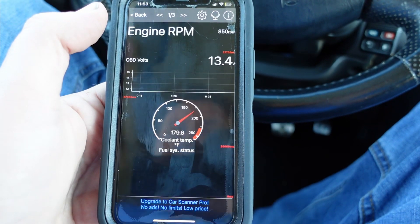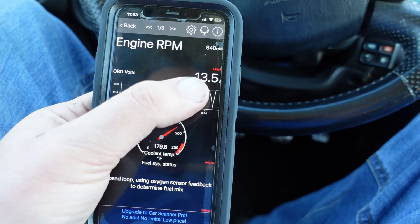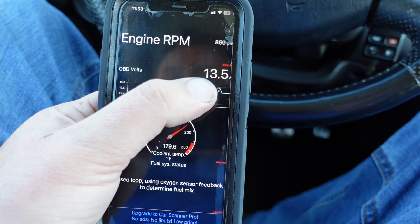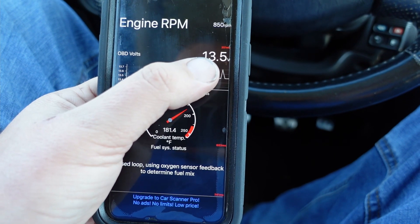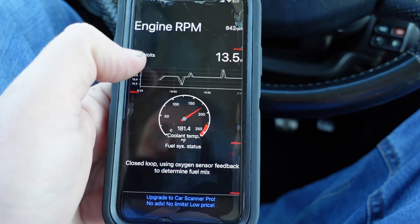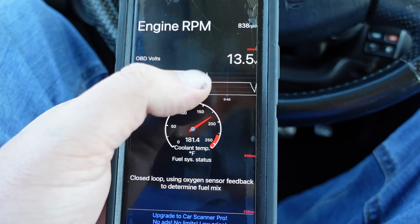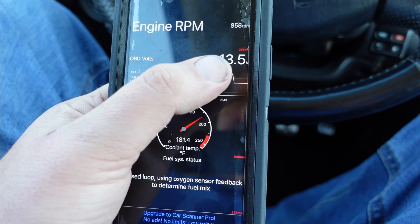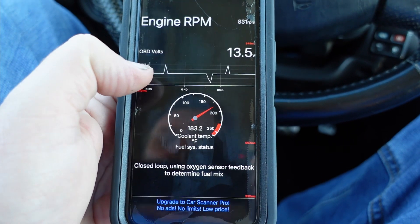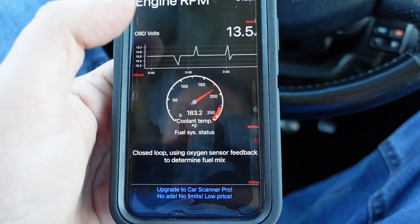Let's go to the dashboard — I'll show you what I've got set up here. So I've got my battery voltage. I'm monitoring that because I'm troubleshooting some battery stuff — it feels like it should be charging a little higher. I'm seeing some fluctuating on my dash light sometimes, jumping from like 13.3 to 13.7 volts. I'm trying to figure out if that's an alternator issue — that'll probably be another video.